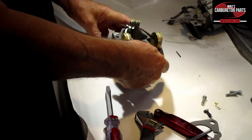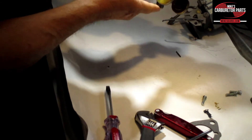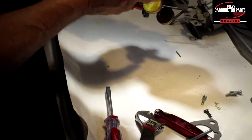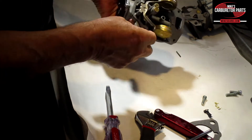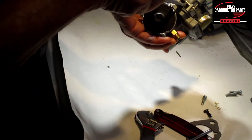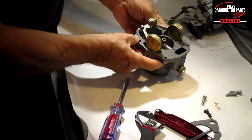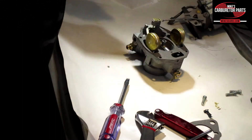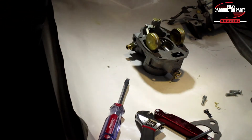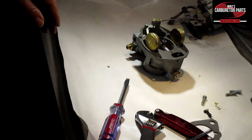For the float drop, turn it right side up. We're going to measure from here to the bottom now. Use the spec off your spec sheet — I'm not going to tell you what it is because it's different for different vehicles. You adjust the float drop with this little tab right there. Look at your spec sheet; if you can't find it, get the closest engine on the spec sheet and use that measurement, because carburetors get swapped around so much that spec sheets are really about the original configuration.